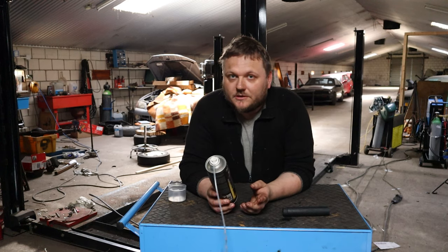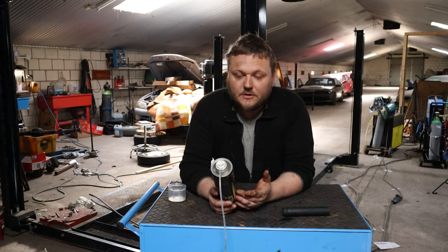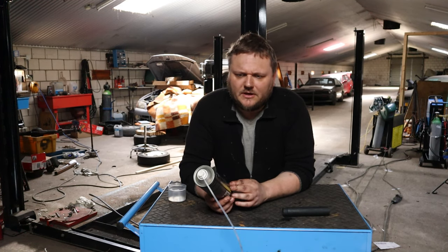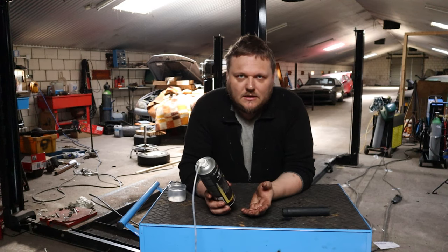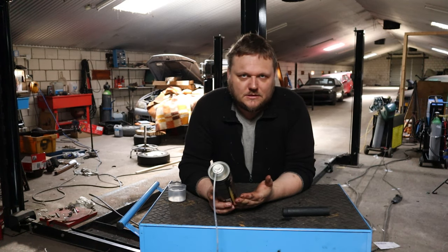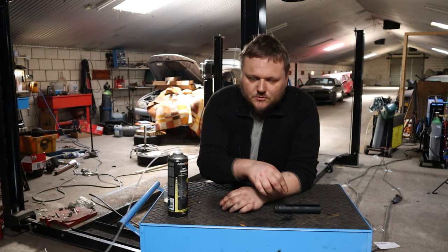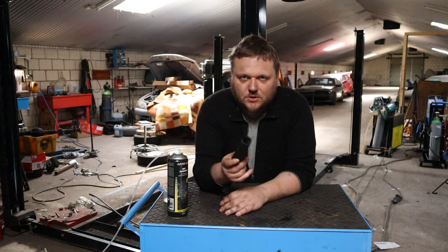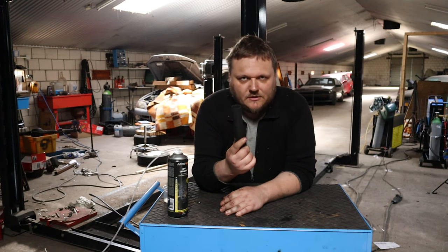It did work on my brother's car. This is of course a lot cheaper than replacing the particle filter, and also a lot less work — so why not try it at least. These cans are not that expensive, something like 15 euros. Maybe it also helps removing some errors in your system. So if you are going to do the O2 route like I did, get yourself one of these O2 sensor sockets — these are 22 millimeters. It definitely makes your life a lot easier.